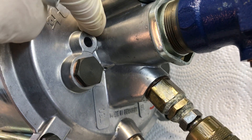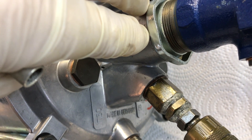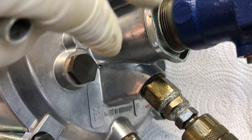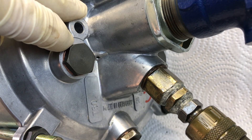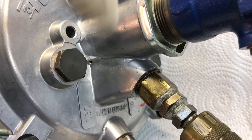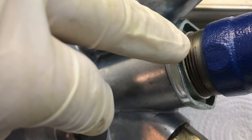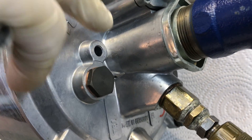In some instances they had actually left parts out. I found on your booster that the special spring steel retainer that keeps the slave cylinder onto the vacuum shaft had been left off. So your booster would not have survived very long — the slave cylinder inside, the piston itself, would have come off of the vacuum shaft and you would not have any boost, and possibly could have had the piston slide sideways and get entangled inside the slave cylinder, really messing things up.